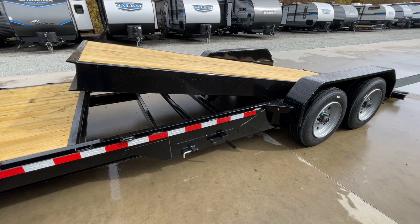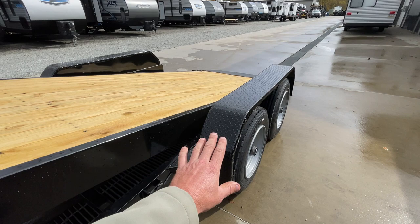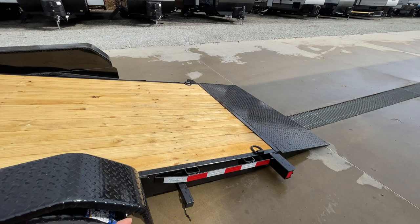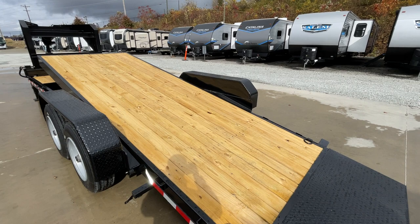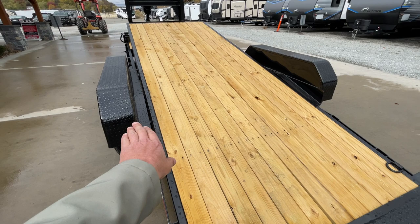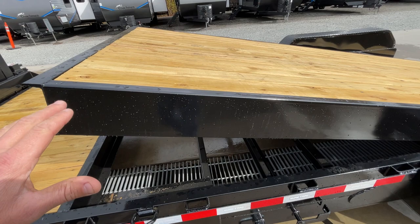Notice this is a four inch ring, not your traditional three inch ring. Specific to the fab part — a couple little things Short Track does different. Some manufacturers, the fenders will rise with the trailer. On this, they stay on the ground. The bed on this is about 76 inches give or take; fender to fender you get about 82. Some other manufacturers will do a fabricated part out and down and then the fenders attach to that, which is why they go with the fender. So Short Track does one of two ways to do it.